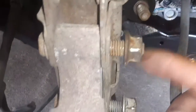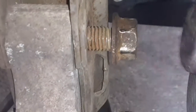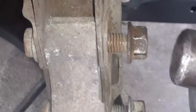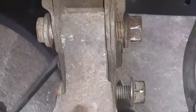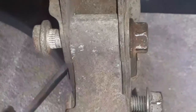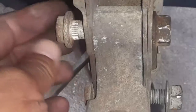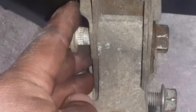You see how it's flush with the bolt? You're going to be hitting it so you can push this screw out. Just tap it. You see how it came out? You see how this screw has threads? So when you tighten this bolt up, the screw goes in with pressure. The reason it has threads is because it doesn't have a head on this side where you can hold it with a wrench. So you tighten it up and it holds itself with the spindle.